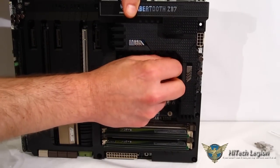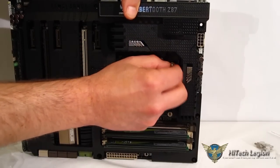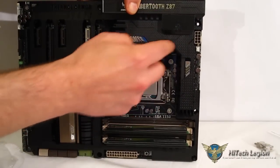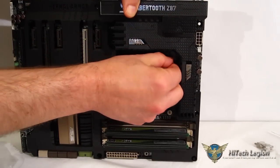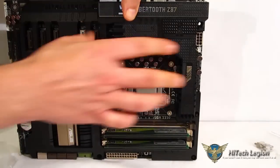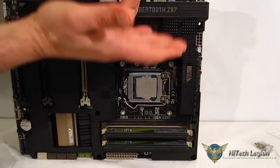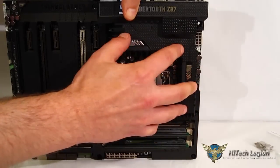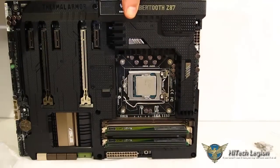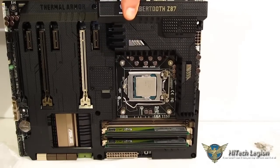You'll notice it's a little tight in the corner. The Sabertooth board I'm using is exaggerated as far as heatsinks go, but anything with tall adjoining heatsinks is going to make this corner very difficult to get to — and you're going to see that not only here but also with the tie-down bolt. Even with just a heat pipe going between the two, you might have an issue. So that's something to bear in mind, and a big reason you'll need to take the fans out in order to install the cooler.